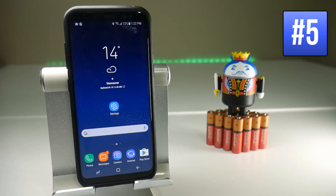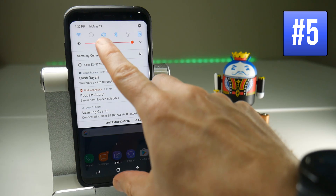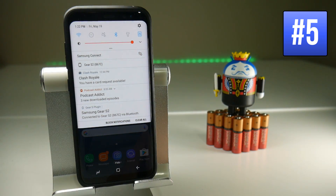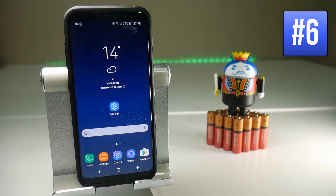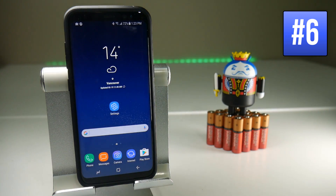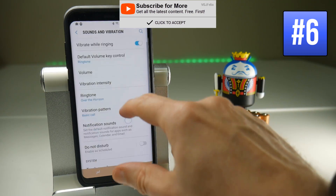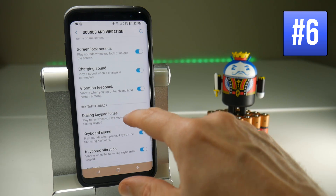General sounds can also use battery on your device. To turn that off on a wholesale level, go to Settings and then tap on the volume button — that will set it to vibrate mode, but you can set it to completely silent mode by tapping on the volume again so that's muted, and tap it again to turn everything back on. You may also want to consider disabling system clicks and keyboard clicks by going to Settings, Sounds and Vibration, scrolling down until you find Touch Sounds and further down Keyboard Sounds.